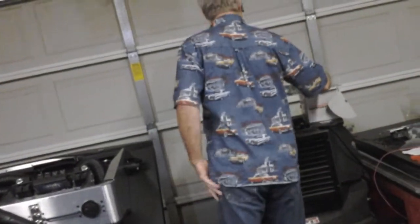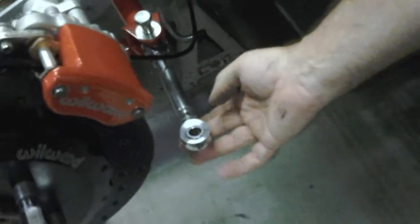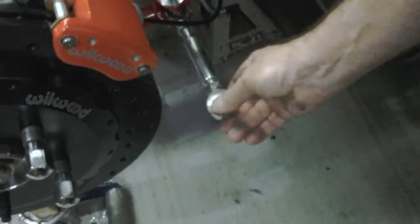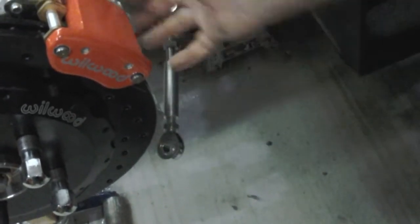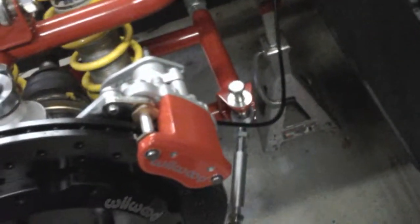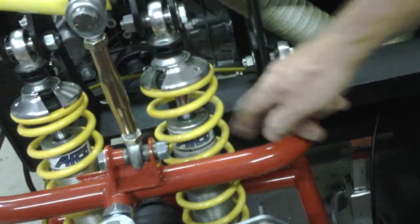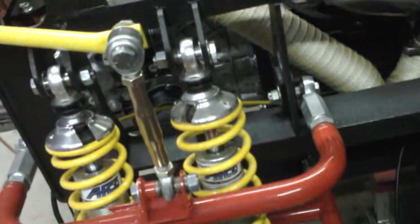You can see this right here. Again, the rod end supply with the Teflon impregnated, permanently lubed pieces. That goes right there, sets the toe on the rear. That's setting at ride height right now. At ride height, these are 5-inch shocks, and you got 2.5 inches of stroke right here. I want to go back and look at this stuff that we looked at earlier.